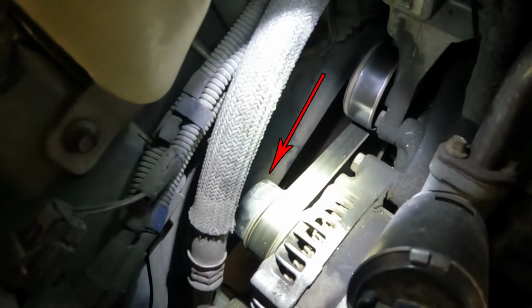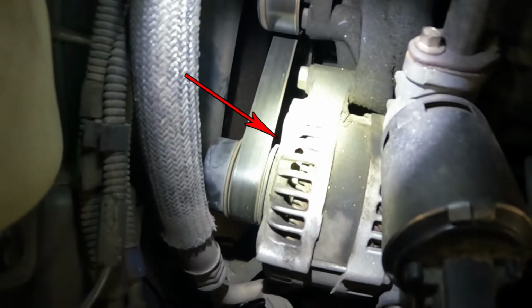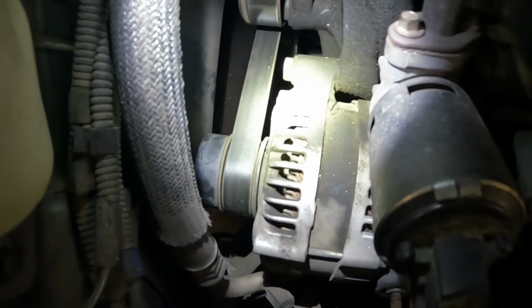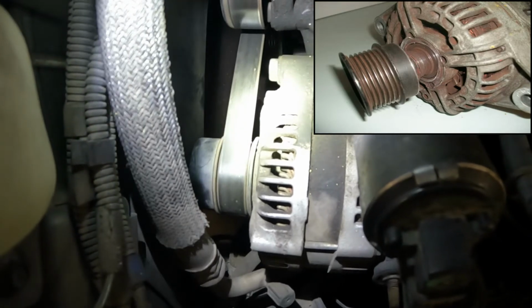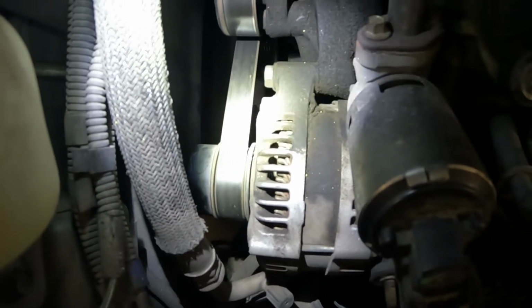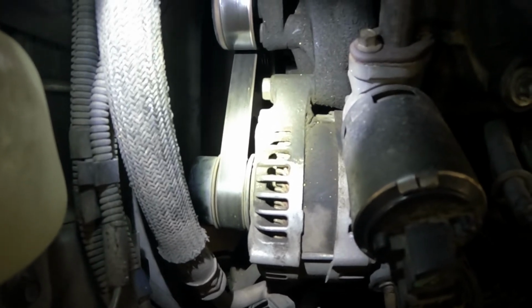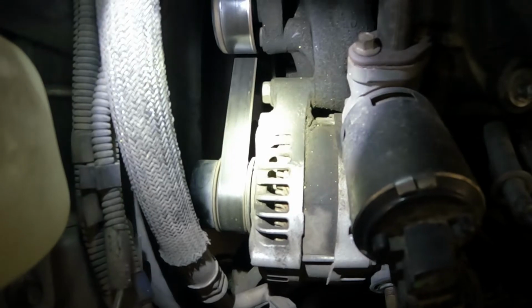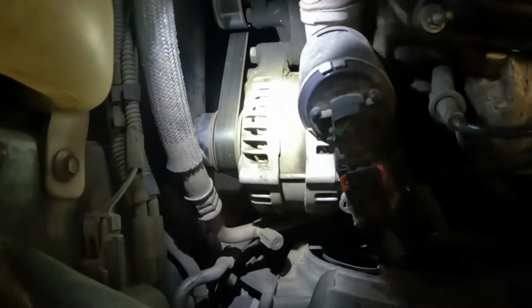When those bearings inside go, usually the first thing you'll see, I'll put an arrow, towards the alternator, is a lot of rust dust all over the alternator. That'll be your first clue. It's just an indication that the bearing's gone dry and it's packed it in. It will sound like an engine knock. You will swear that engine is toast if they're bad enough, and it's just that. You take the belt off and the noise goes right away.